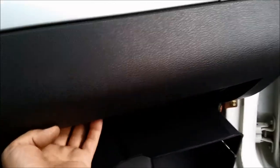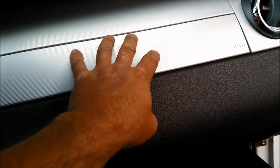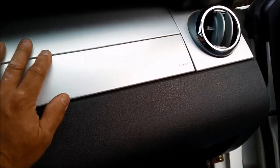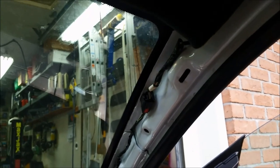Just be wary of airbags — side curtain, A-pillar, and even here in the dash. If you're running a wire along the dash panel, make sure there's nothing between the panel and the bag, so if the bag blows you're not getting a face full of cable, antenna wire, or microphone cable. There are a lot of accessories nowadays, and people may feel the need to run wires up the pillar or wherever — just be careful, be diligent.